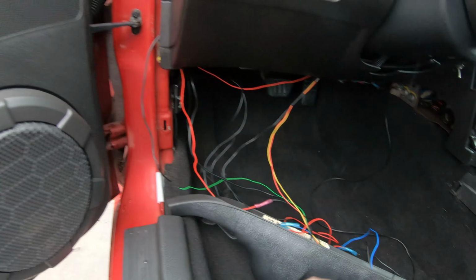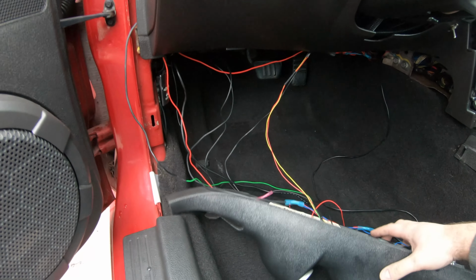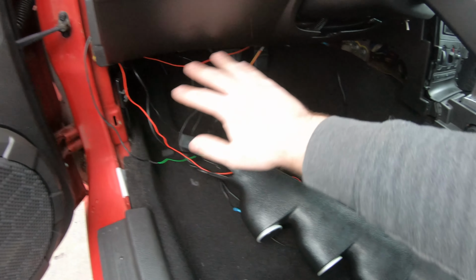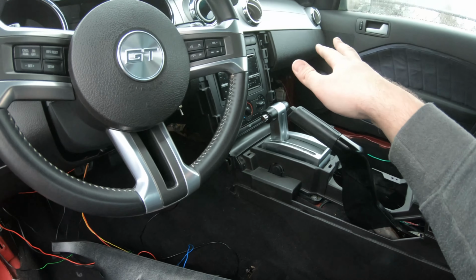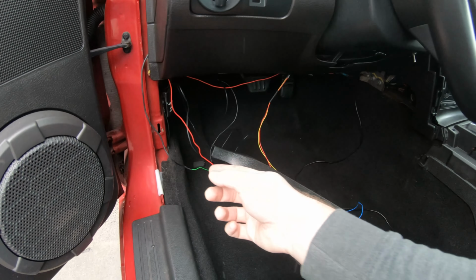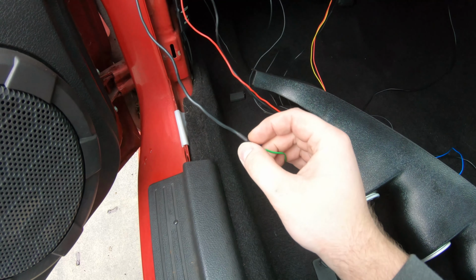They're all buttoned up together. It's causing my gauges to read oddly most of the time. So my plan here is to just remove all the grounds, remove all the power lines, run completely new ones, and solder everything, so they're going to be tiny. This one I just tested before I decided I'm just going to rip them all out.